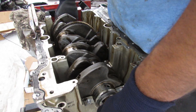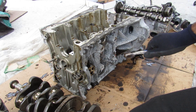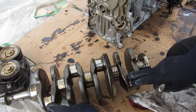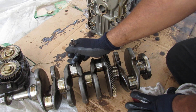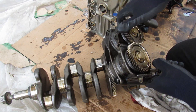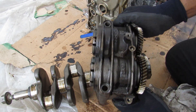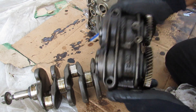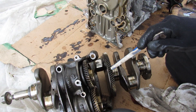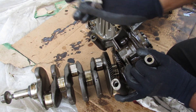Now we can lift the crankshaft out. Here's the engine all taken apart. Starting at the crankshaft, you can see a typical 4-cylinder layout with two pistons on the bottom and two at the top. This is the bearing surface where the connecting rod that spun a bearing was connected — and you can see it is scored up. Because 4-cylinder engines have secondary moments of inertia causing vibration, Mercedes has installed a balancer. It's almost as heavy as the crankshaft itself, with a double gear system that interlocks with the gear on the crankshaft, and it has weights rotating in the opposite direction of the pistons to counteract their inertia.